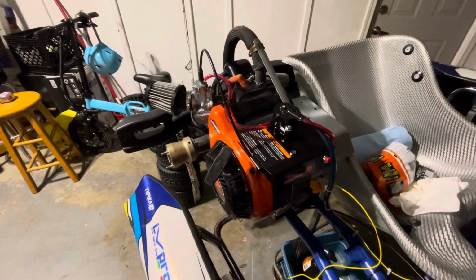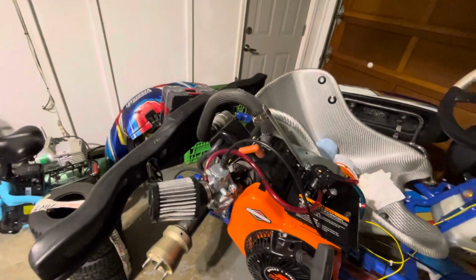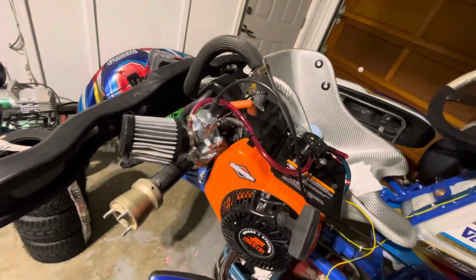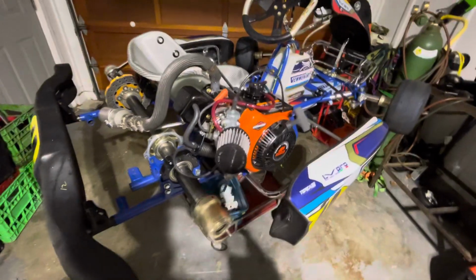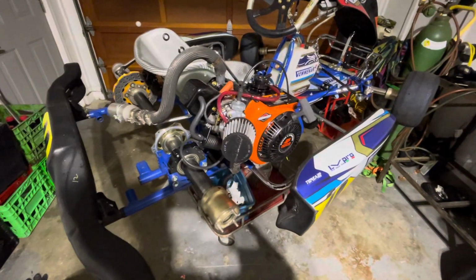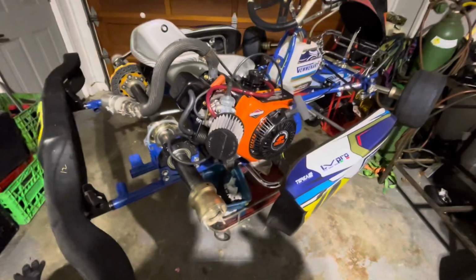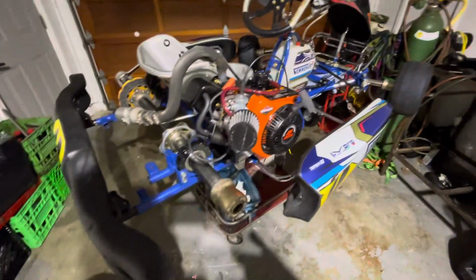So most of the work you can really do on these is in your head. So making sure your valves are sealing all the time. Compression is the biggest thing on these motors, and your valve lash. When you change your valve lash, say your exhaust is 2 thou and your intake's 4, or you want to go vice versa, you can change the cam timing a tad with that, but very minimal, right? So most people run like 2 thou clearance. Some people run 0, but I like to run 2 and 4 for some reason. That's what I do. People might disagree or agree. I don't really care. That's what I do.